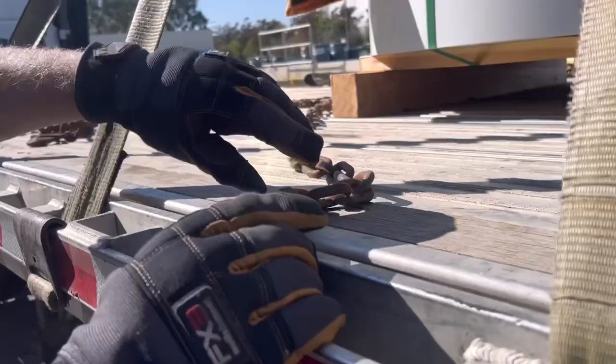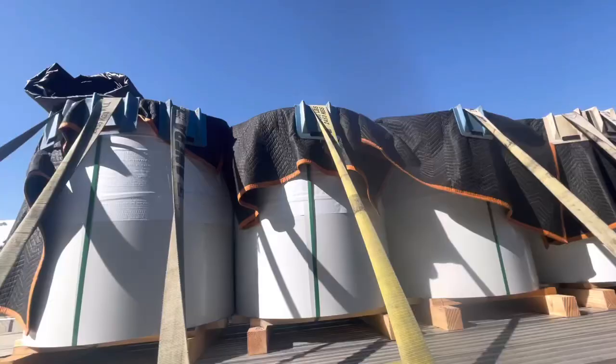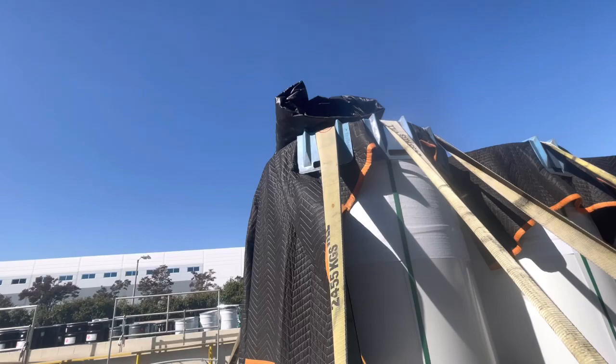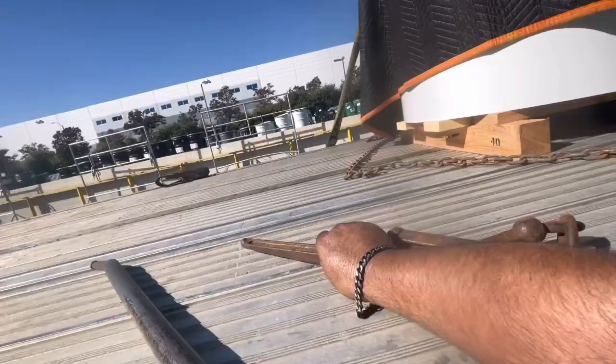All right guys, we're putting the trip chain on now. We've got edge protectors, packing blankets — everything is nice and tight, secured, edge protected. Rule of thumb on edge protection is: if your gear can damage the material or your material can damage the gear, that's when you want to use edge protection. Our coils are protected. Our tarp is going to be protected from the coils with the packing blankets, and our straps are protected from the coils with the edge protectors. We're going to need one tarp — we've got it up there. We're putting the trip chain on now, and our binder will end up being on the passenger side. That chain is going to keep those coils from sliding forward.